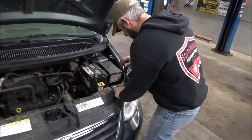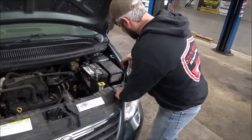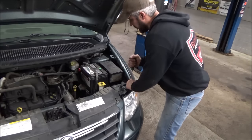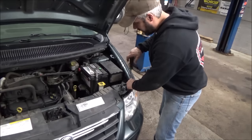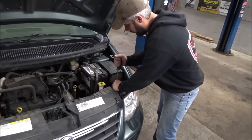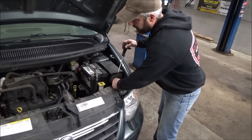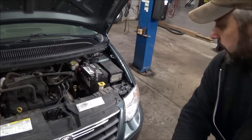I'm a little pressed on time right now, so we're going to skip a couple things here. Right now the engine is fully warmed up — it's actually pretty hot. I did check the fans to see if they turn on with the AC; the fans do not turn on. There are two cooling fans and neither one of them turns on. The guy doesn't have a complaint of an overheat, but he also hasn't left it sit and idle for any extended period of time.